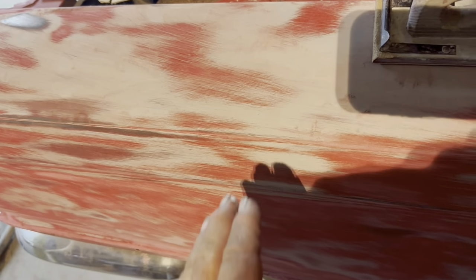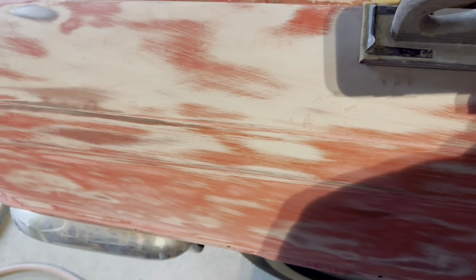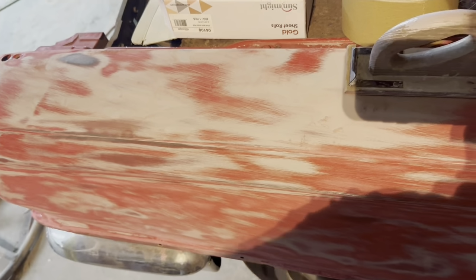You cannot do this kind of job, or how I'm describing it, because what's gonna happen is you're gonna have a ring around here where the paint peeled back, and it's gonna shrink back around here over time, and you'll have all these little rings all over the car. It isn't gonna work. Only if the car is feather edging, and this paint is feather edging really, really well.